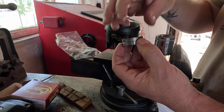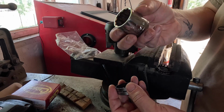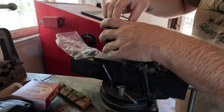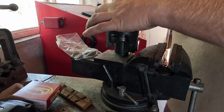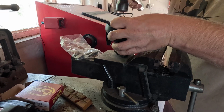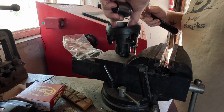So I'm going to use the old race to stack on top of it. Problem solved. And then the perfect socket. In my case, it's a 30mm Duralast brand, but they can all be different thicknesses, so good luck there. We'll set in the good bearing, black piece facing up, set in this old race, set on this socket. That's the sound of solidness.